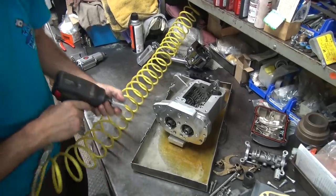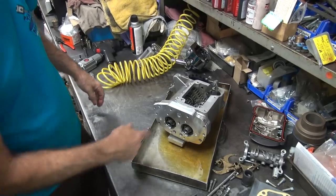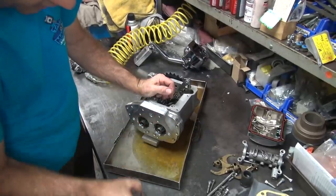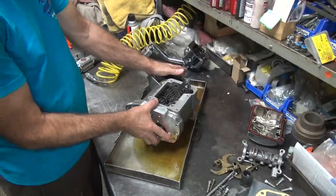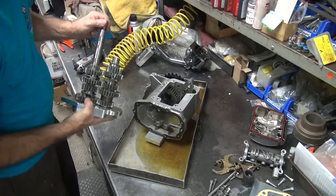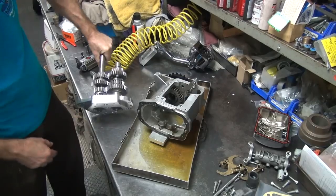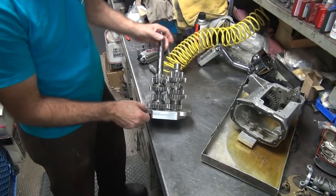So do you try to compress it a little bit more so it's 30 thousandths? No, I'm going to have to do some playing with the washers over there. The spacer will have to be shortened up, and I'm going to measure them and see if they're the correct ones. And see, the first time I assumed stuff was made correctly, so we know what that means. That means we get to redo everything. Okay, so I'm going to go press this back out again, and I'll measure both of these and see what's going on, because right now it's all wrong.